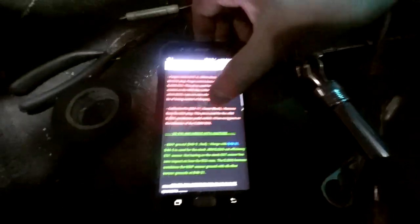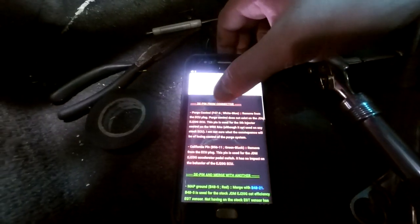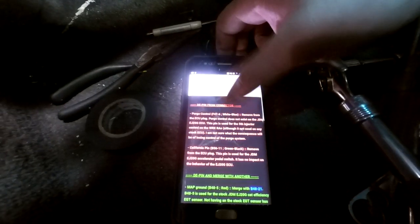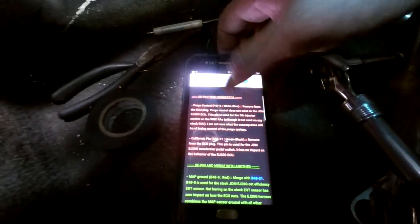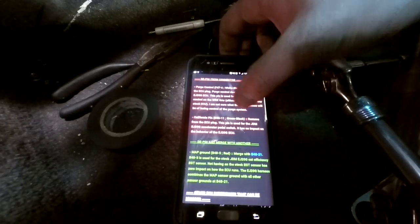Let me see if I can pull up the diagram here. Yeah, so this is the link that's going to be in the description. So there's a purge valve, or purge control valve solenoid, which is F47.6. I don't think we actually did anything with this because it's not used in the 20G ECU, so I'm not sure how necessary it really is to remove it from the ECU. It doesn't go anywhere, so I'm not sure what the issue is there.